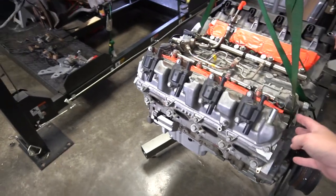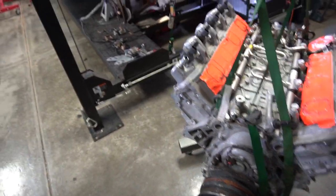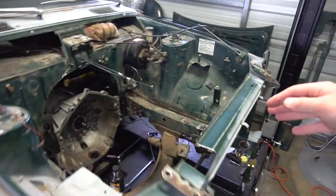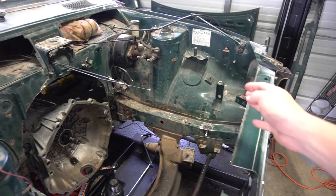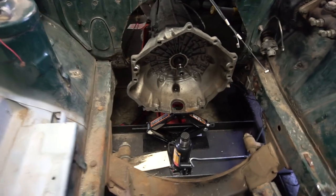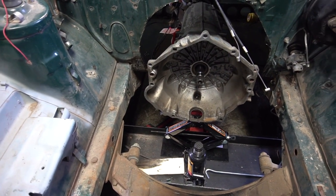We've got the engine back out. Something kind of crazy is the engine has to come out almost sideways out of the engine bay because there's just not enough front-to-back room — the balancer wants to catch. Hopefully going to the shorter balancer, it'll let me come almost straight up with it. I ended up using a little jack to hold the front of the transmission.